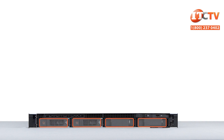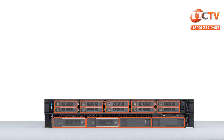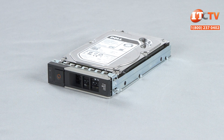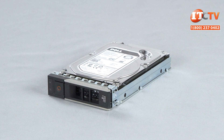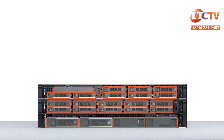In addition to the four 3.5-inch drive bay configuration, there's also a 10-bay 2.5-inch chassis version. The 10-bay system can also be set up with four NVMe SSDs for a maximum storage capacity of 48 terabytes. The 4-bay 3.5-inch chassis supports a maximum capacity of 40 terabytes using 10-terabyte 3.5-inch HDDs or SSDs. There's also an 8-bay version that supports an optional optical storage device and VGA port.